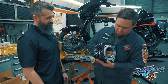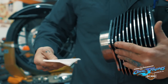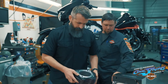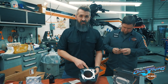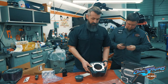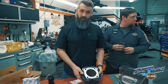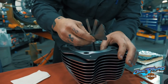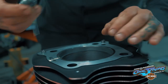You notice even with brand new cylinders — look at all the grime that comes out of there. You always want to wash them. Use white paper rags and then wash them until it comes out clean. So Mike already has the cylinders all cleaned up. We have a ring in here, and even though there should be factory gap, we're going to check everything that Harley's done just to make sure they're within spec. We'll have a feeler gauge go in the middle, make sure that the gap is exactly where Harley-Davidson has recommended, and then we'll run it. These pistons are super consistent every single time, no exception.